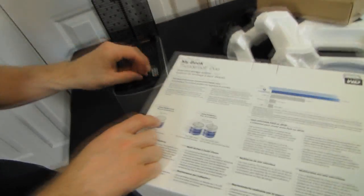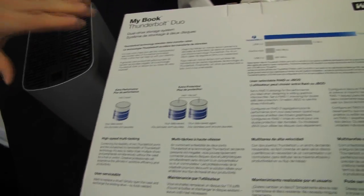So extra performance with RAID 0, RAID 1 mirrored — do more work in less time. Why would you want a Thunderbolt external drive? Thunderbolt is up to 10 gigabit per second, although until hard drives get a fair bit faster, even with RAID 0 we're not going to max that out. This is for professionals and notebook users — if your notebook has Thunderbolt, you can use this for huge mass storage on your desk, plug in one cable and your desktop monitor is on and your storage is connected, without fumbling around with a bunch of different cables. Usage scenario number two is you need high performance, reliable external storage for a desktop PC for professional use. It can be more convenient to use an external storage device rather than throwing drives in and out of your computer tower all the time, especially on OEM computers where it's a real hassle to fuss around with hard drives.